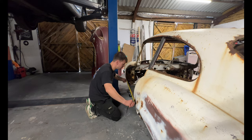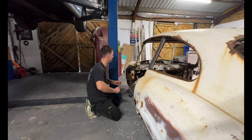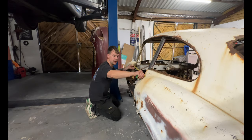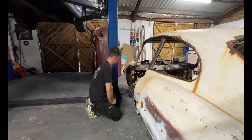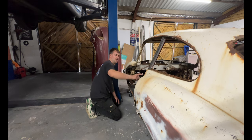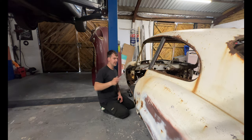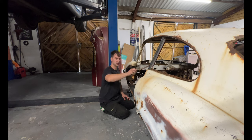That's a turn-up for the books - the lower measurement across the sill is absolutely bang on. Checking the second measurement - absolutely perfect, to the millimetre. So now I'm going to start putting some strength in. I'll go diagonally, because triangulation is the key here, and I want to keep it out of the way of anywhere I'm working - probably from up here down to the bottom.